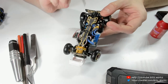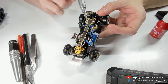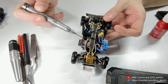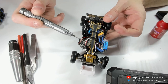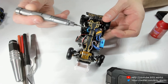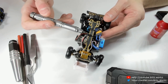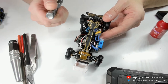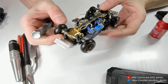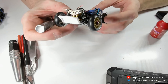Moving forward in the car — I spent the time to put the cables underneath. Originally I was going to put them on top, and if I did it again I would, because this metal plate that allows you to adjust the length means there's not a lot of room for the battery. The battery does swell during usage — it goes from being tight to almost impossible to remove, and you have to let the car cool down. I should probably be using better batteries.